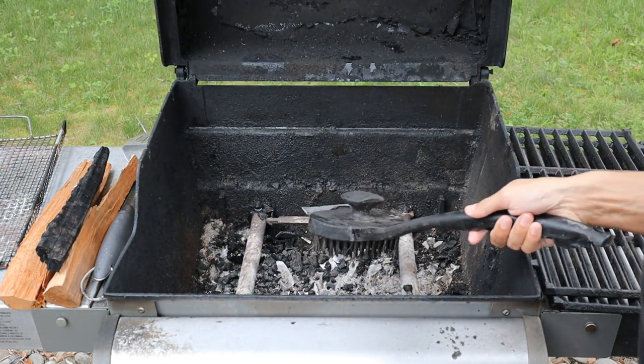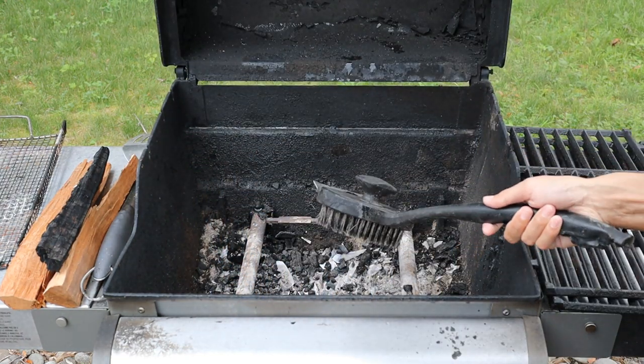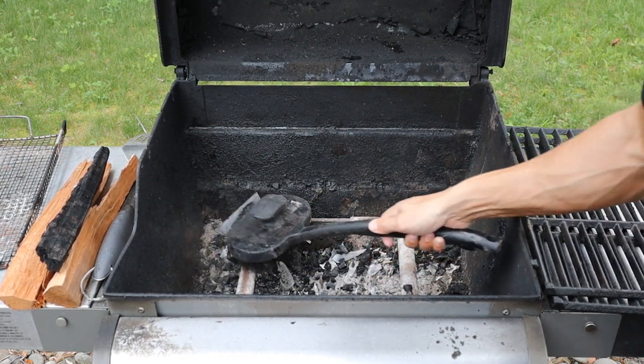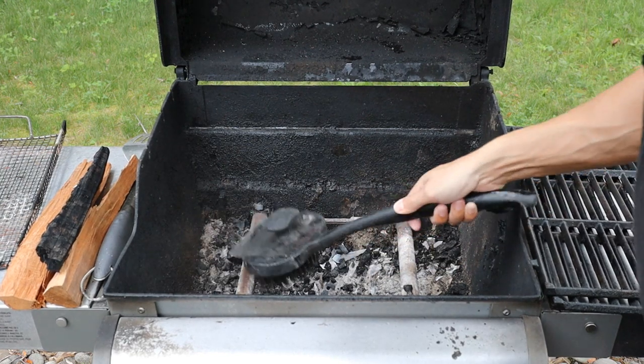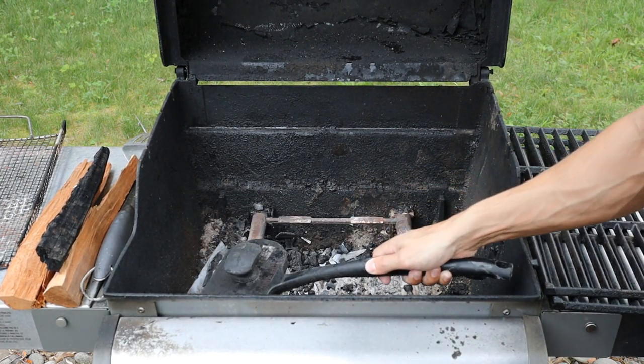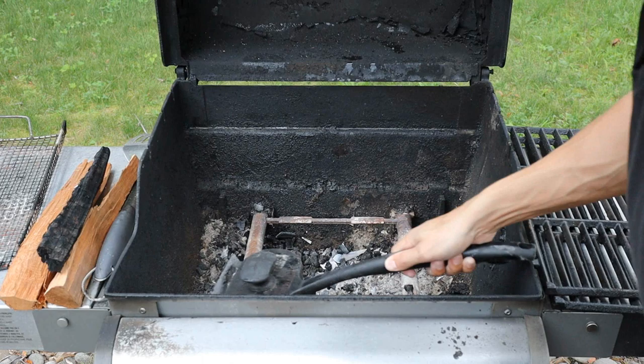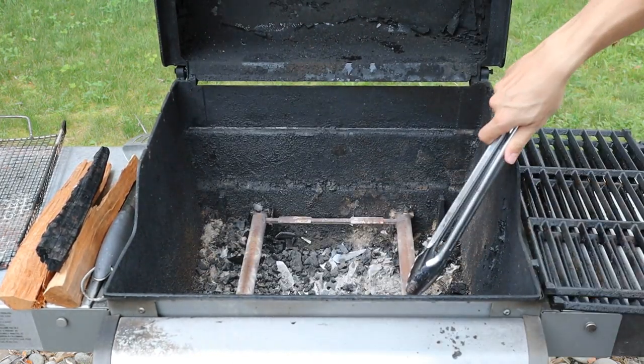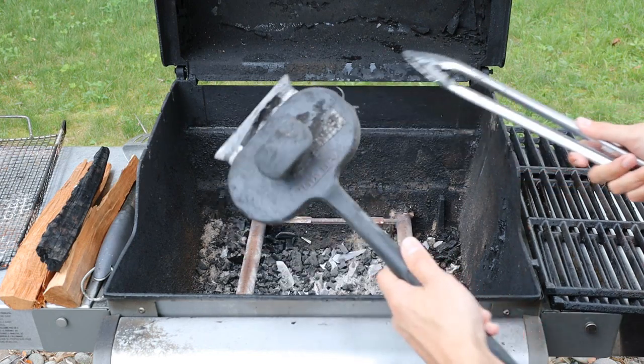As you can see there's quite a bit of ash and these burners are very beat up. What I have to do from time to time is come in here with a bristle brush and clean out the burners so the gas comes out properly. This gets any clogs cleared right out.